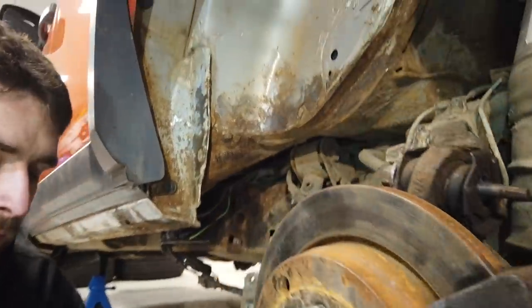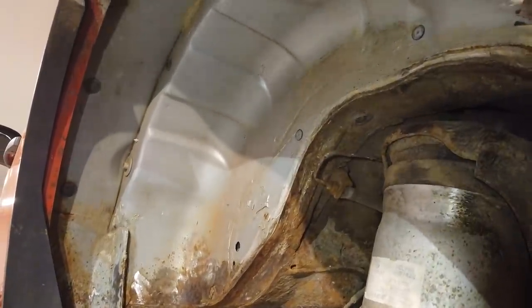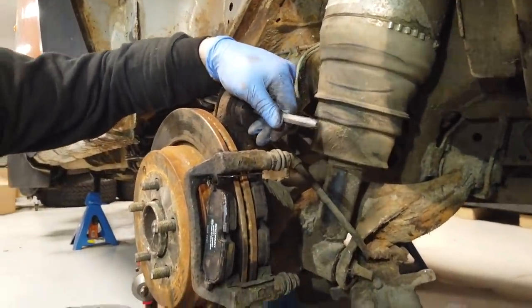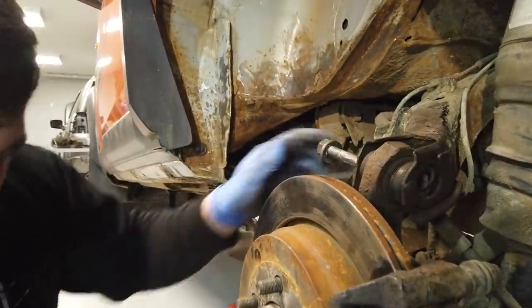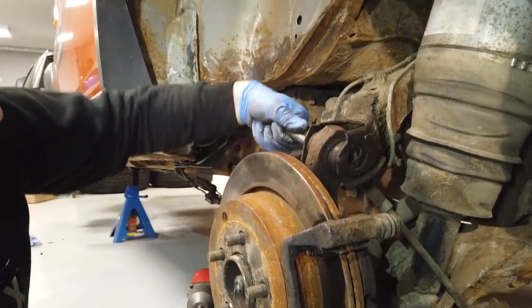The hub nut's off, the bottom bolt's off, and the tie bar's out. I just want to show this top bolt area - that is where your camber adjustment is. Now Gary, take that top bolt out. Give it a little tap - we know it's mainly loose. Take the weight off it - you may have to wiggle the hub as well. Use the drift to knock it out.